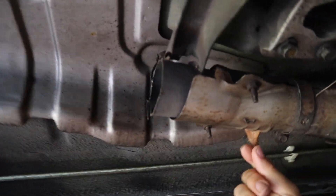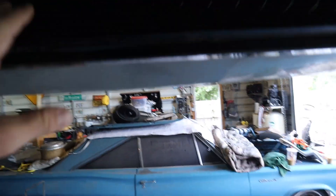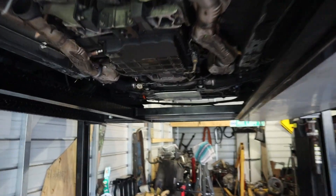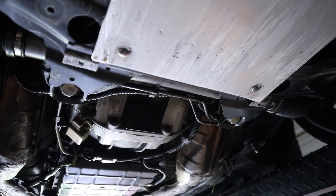You know you're missing half your exhaust, right? That's why it sounds like it's chopping. From this angle it's literally one finger length off - a good bit smaller than it looks from the other side just because of how far back it is. Rear subframe doesn't really look like it's hit. Diffs are quite high on these cars compared to LSs. The trans pan just has a couple scrapes - I'm sure that's from going over restaurant entrances. Skid plate's putting in some work - that's thick, good on you. It's been working. Power steering leak - we'll hop on that.